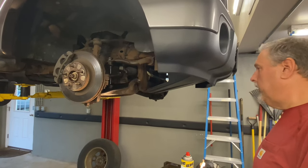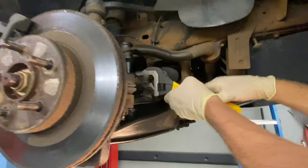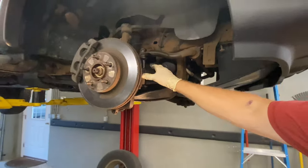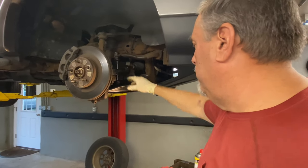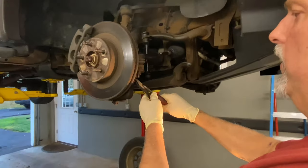This is a 21 millimeter wrench — we have an adjustable here to crack this loose. We're going to leave it loose because we're going to thread the new tie rod back on the same number of turns we took off, and then we're going to set the toe on it after we're done. So let's start by taking the tie rod end off and bending the clip back.